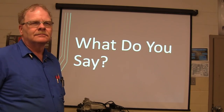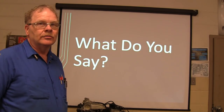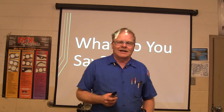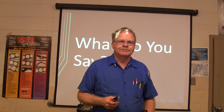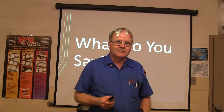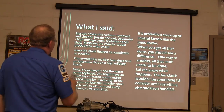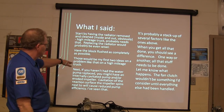Could be a bad thermostat — though the thermostats I've seen would be bad by opening too soon. One time I got an email and the guy said, 'When I fire my car it make a womb noise, what can cause it?' I had no idea what he just said. My answer was: start by having the radiator flushed clean. Have a block flush. That'd be my first two ideas.